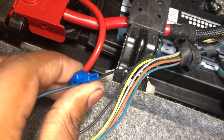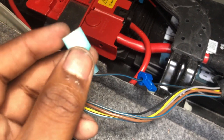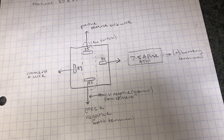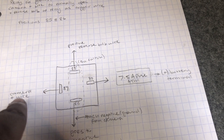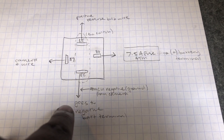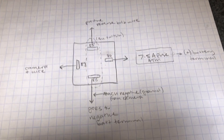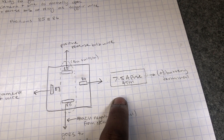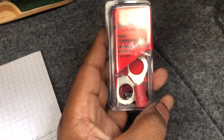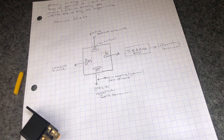I've got half of the tap in place on the reverse wire. The second half goes to the relay at pin 85. Here's my diagram — pin 85 goes to the reverse wire, pin 87 goes to the camera positive wire, and both grounds (for the relay and the reverse camera) go to the negative battery terminal or the ground wire from the reverse light wiring loom. Then pin 30 will go to the 7.5 amp inline fuse holder, which connects directly to the battery using ring terminals for a cleaner install. That should basically be it — I'll get the wiring done and show you how it looks when complete.